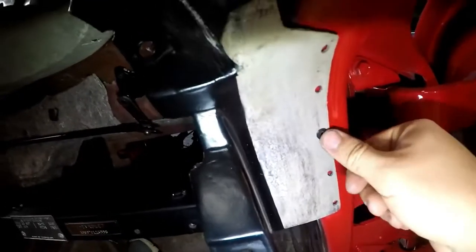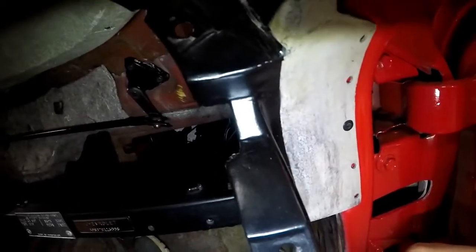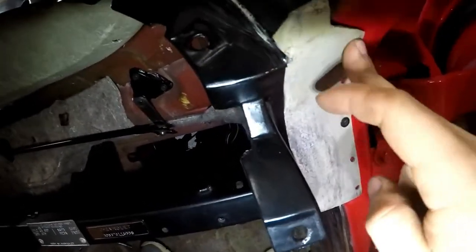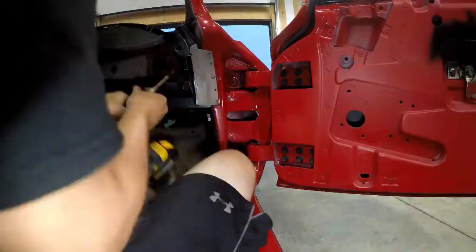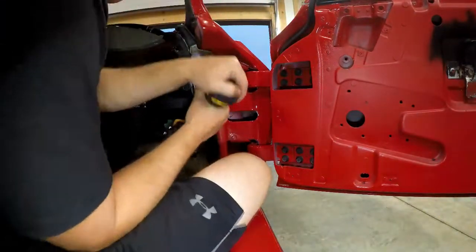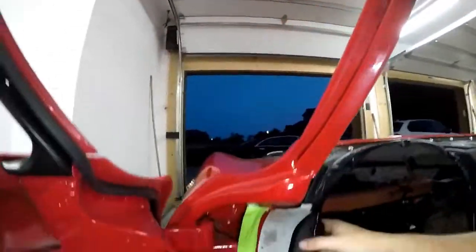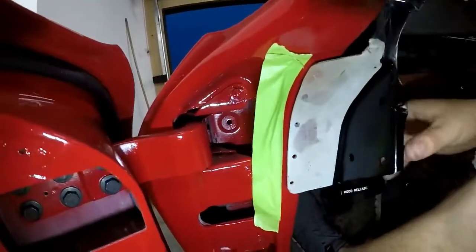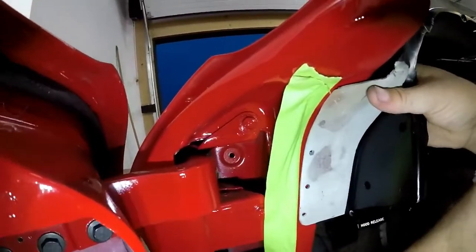I drilled my 1/8-inch hole and my 3/16-inch hole. I held the dash tight and put my first pop rivet in — I'm happy with that location. I'll just work my way around and get all these done, then move to that side. That side is done and I can finally latch the door. I'll line this side up with a little bit of tape because I accidentally made a couple of little bumps on the other side, but that's okay — we're going to paint these anyway, so it'll just be a little extra touch-up.